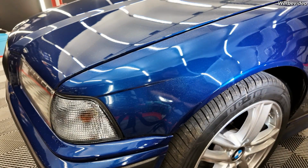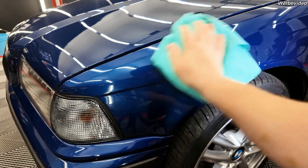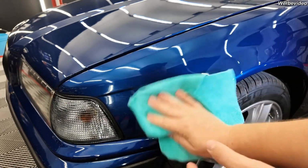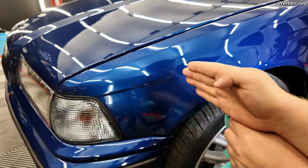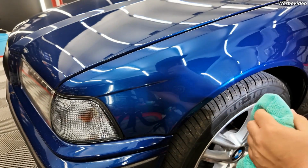So you can already see the handling of a rotary polishing machine. I'll summarize it like this. It's simply different from that of an eccentric. You go clearly, so at least that's how I do it. I move noticeably faster over the surface and can check more often. Has anything changed? Has perhaps a stronger haze come in?